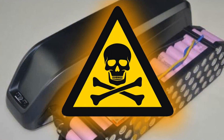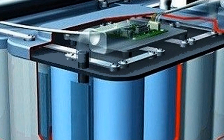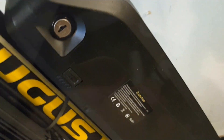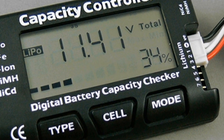He called to see if the problem might be the conversion kit. The people he bought the battery from asked him to take the battery apart and test the battery management system. I let him know that if you open up your battery, your warranty is null and void. The BMS is a small computer inside the battery that manages the discharge and charge of individual cells, and it also talks with the controller managing power distribution to the motor. When he tested the battery off the bike it showed a full charge, but when connected to the bike and he turned on the LCD controller, the bike would shut down. I asked him to connect the battery to the bike and then plug the charger in — when he did, it worked, indicating the battery wasn't holding a charge. Since then he's gone off and gotten his battery fixed.